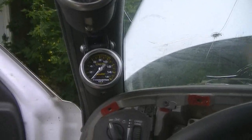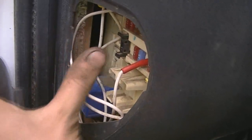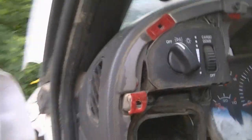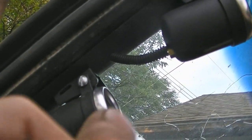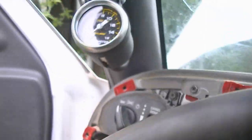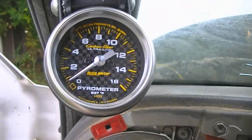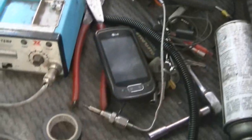Boost and pyro are installed. I've got the key-on wired up here for now — it's just temporary, I need to spend some more time and tidy that up. Everything is run down through here real neat and both have been conduited. That's the airline — you can't really bend it that much. And the other is just wire so I looped it up like that. I can't have it hanging down too much or it would interfere with getting the dash bezel on and off. Turn the key and you guys can see it light up — yay! And this guy twitches. I need to get the manifold drilled and tapped.